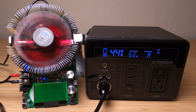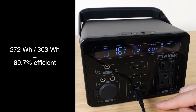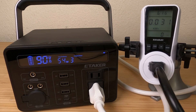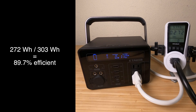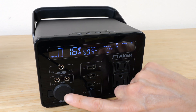Discharging from the 12 volt adapter at 10 amps took 2 hours and 17 minutes, yielding 272 watt hours — an efficiency rate of 89.7%. I also discharged it through the AC port at 310 watts; it cut off around 8% remaining, so I reduced to 110 watts and also got 272 watt hours at 89.7% efficiency. Typically AC output is less efficient than DC, so I'm pretty surprised these two results are so similar.